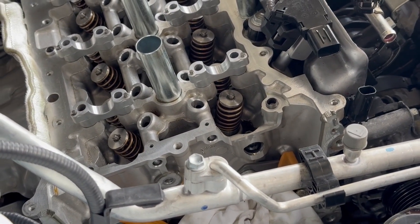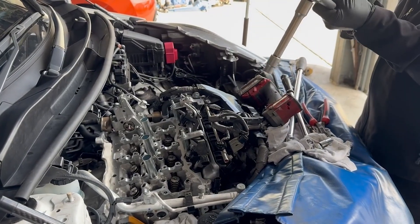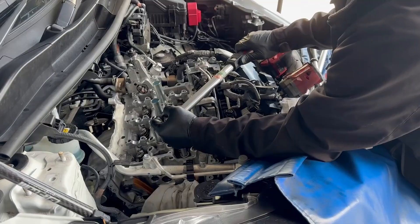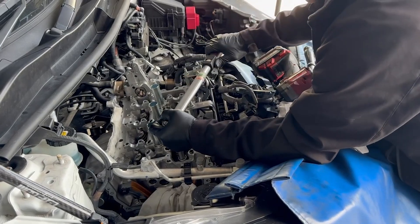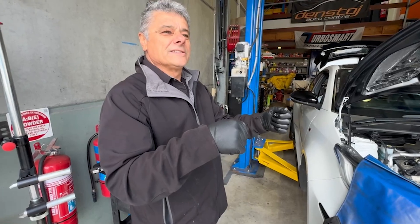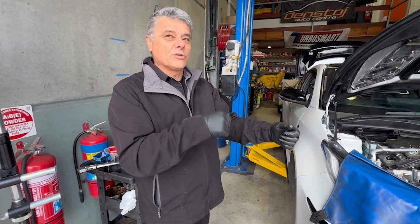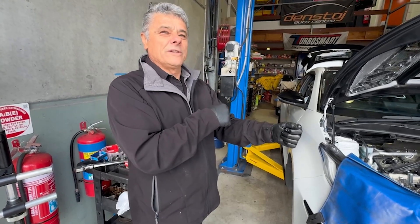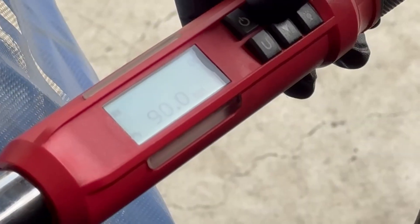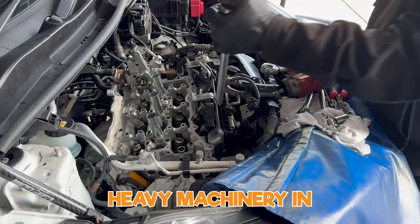You don't want to leave the stud hanging out. First torque setting is 80 Nm. M11s go to 108. It's the washer grabbing, so you've got to make sure you're going far enough - if you turn it at 70 degrees you know you've got that stretch on the bolt. Doing it with a torque wrench isn't always exact because of friction.